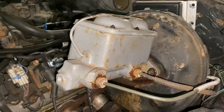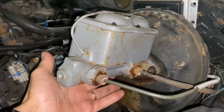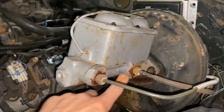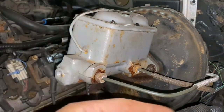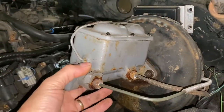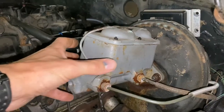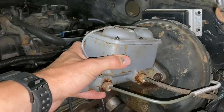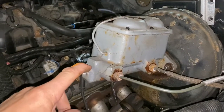The first part of this math equation is the master cylinder. Inside the master cylinder is a plunger, and as you push the brake pedal down, the plunger moves up the bore of the master cylinder and takes fluid from the reservoir and pumps it out of the brake lines. The plungers inside master cylinders come in different sizes for different applications, so although the external size of a master cylinder might be the same across different cars, the bore size of the plunger inside might be totally different.